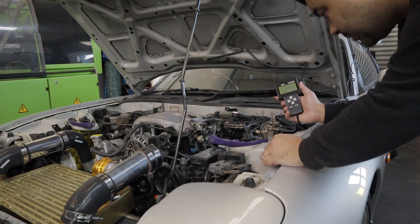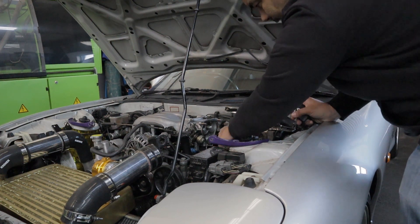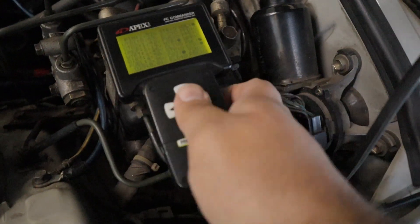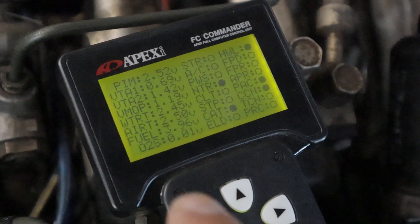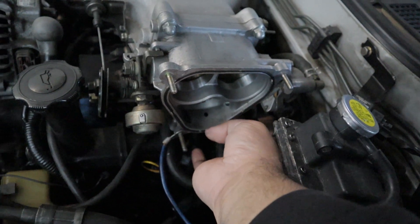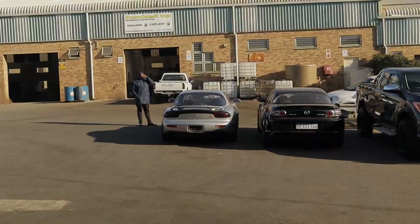My VTA 1 is 0.48 volts right now, but my VTA 2 is 1.08 volts, which should be within range. I've got my settings back to what they used to be before I readjusted them. There's this Haynes-style document that shows you how to readjust your TPS. I readjusted the fast idle cam by pulling on the throttle, pushing the fast idle cam down, then readjusting the idler screw — and now I've got my values back to what they used to be.